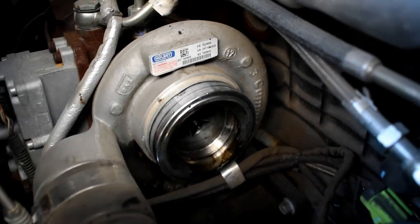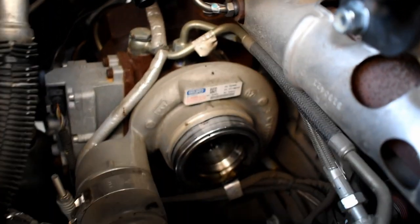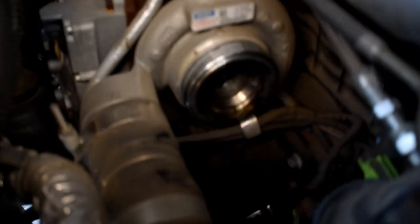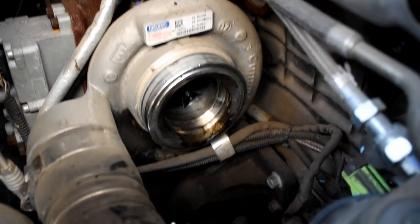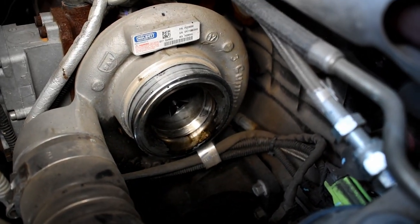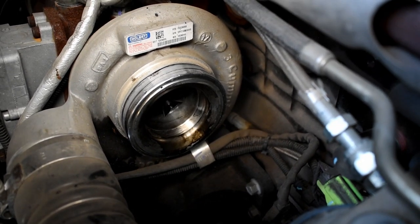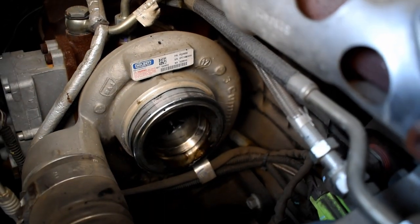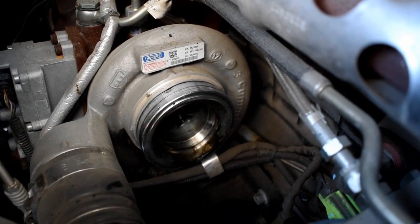I want to take this time to show you guys — as you can see, there's oil buildup in the turbo, clearly coming from this vent tube. Anyway, it's already building up in there, so that's definitely going to be my next little mod. I already bought a catch can and I've already bought some heater hose for it. I haven't got everything yet and it's not in yet — we've had some weather delays here. So that's going to be the next video. If you're interested in seeing that, stay tuned.